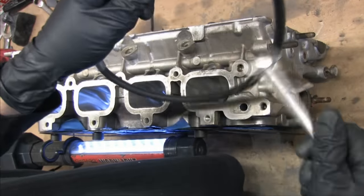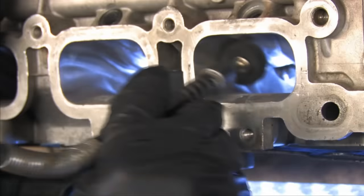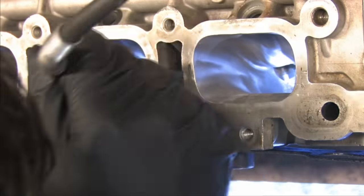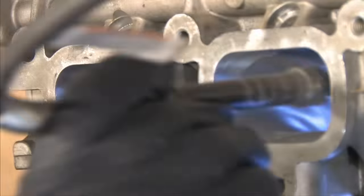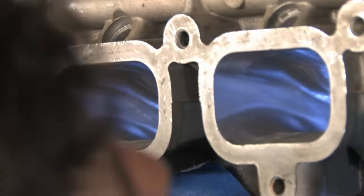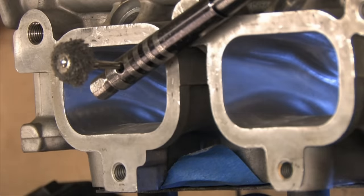My dowel pin trick worked perfectly to obscure the chuck from the part, and if you ever try to do something like this deep inside of a runner, I recommend you also take measures to hide your chuck. Abrasive and cutting rotary tools like to bounce around whenever you're being a dumbass, and in tight spaces it's inevitable that it would touch down and gouge the part. So any metal sleeve that fits tightly around it should protect you. If you have a rotary tool, you already have the tool you need to cut whatever tube or pipe to make one that fits over it, so I don't want to hear any excuses.